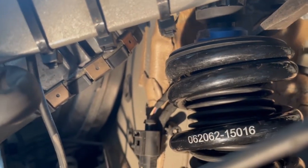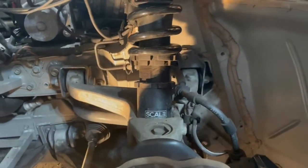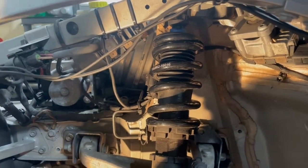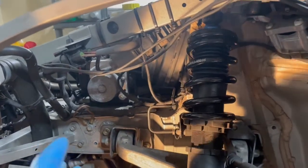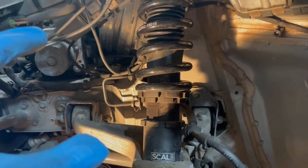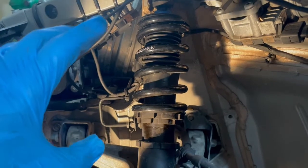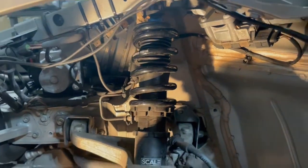So I think we're dealing with a blown-apart shock right now. It's going to take a little bit of finagling to get this out of the way because it wants to expand and take up whatever slack I give it. I may have to come into a situation where I have to unbolt the upper and lower control arms to get the entire suspension to sag enough to get this out. Good sign on narrowing down what the issue is — hopefully this means we can just reuse this once I've tightened it down and make sure everything looks good.